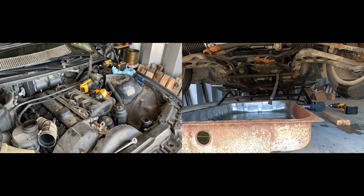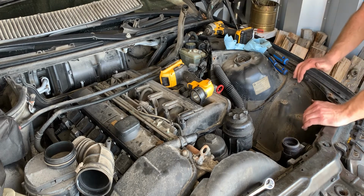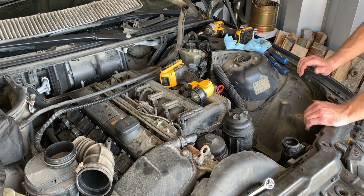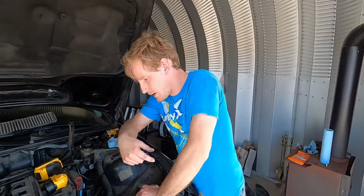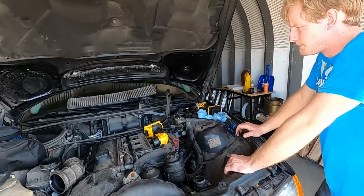Alright, so there's nothing wrong with the, well, I shouldn't say that, I guess. There is fluid circulating through the heater core. Now, if the little tiny tubes from one side of it to the other are plugged, I guess there has to be at least one of them open if the water's going through, but it's just like a radiator. It's exactly the same thing. It's a miniature radiator, so if the little teeny tubes that go from one tank to the other are plugged up, then you're not going to get any heat out of it.